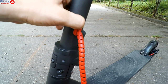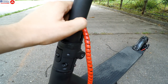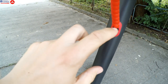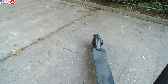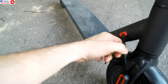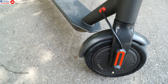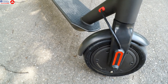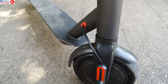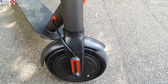They even use the silicone that holds the wires in place, and it's good quality, it's very soft and holds the wire nicely. I've seen this pop out on other scooters, on other clones. Well, on this scooter they seem to hold really nice, and they installed them everywhere. The motor wire is a bit short. When the wheel locks, the cable is just getting to its maximum stretch position, so it could have been just a bit longer, but not an issue because you almost never go full lock steering, and that's not such a big issue.